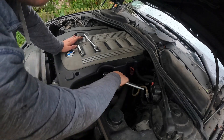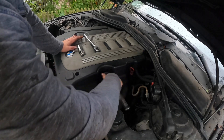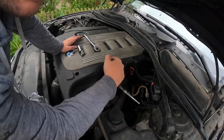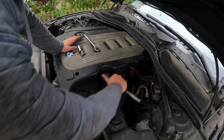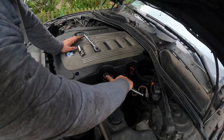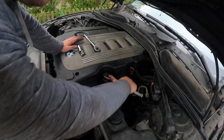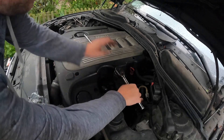Just a note: there's no locating hole on the M57 engine, but on the N47 and N57 there's actually a locating lug, so you've got to make sure the filter pops into that first. If you try to force it without doing that, it will end up snapping the lug and you don't want that in your engine. On this M57 you can put it directly on the filter housing and do it up. Let me know in the comments if that's not clear. There you go, that's all done up.